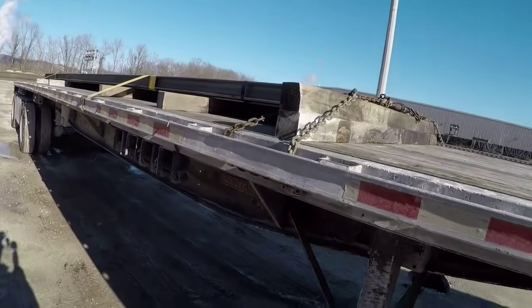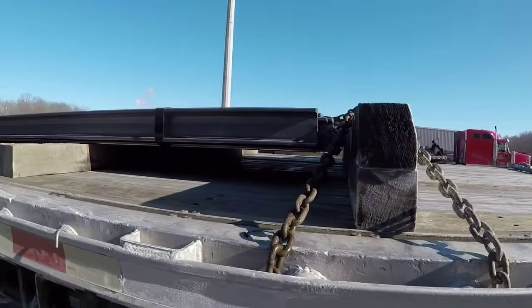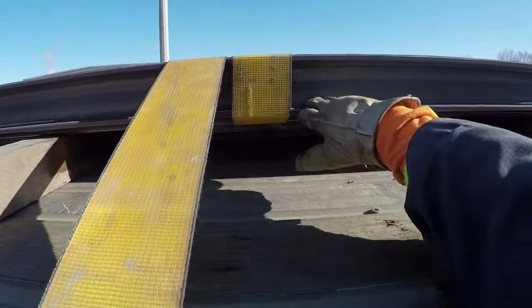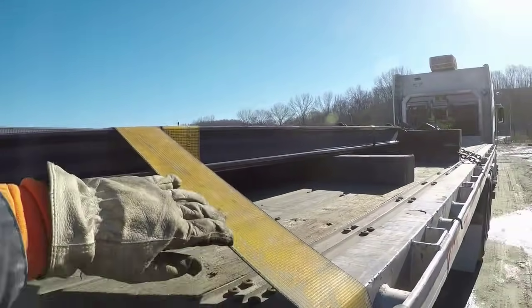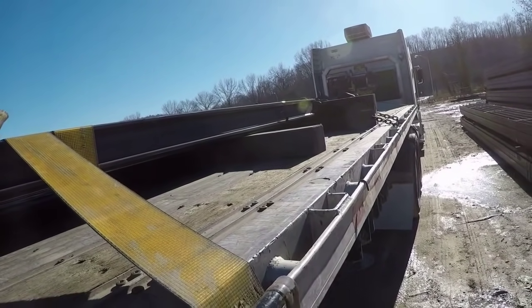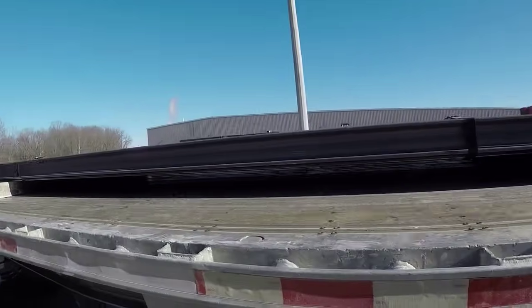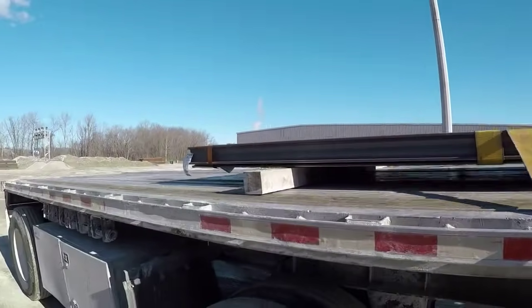I got the truck running — might be a little noisy out here. I got the bulkhead built, so you can see just in case they shoot forward. I went ahead and put a belly — I call them belly barrel strap — around the middle. The one thing you want to do when you're doing these is make sure the strap pulls from the top down. You don't want that strap going underneath and pulling up; you want it to pull down — that helps hold everything down on there. We got another one back here and what that does is it squeezes everything together.